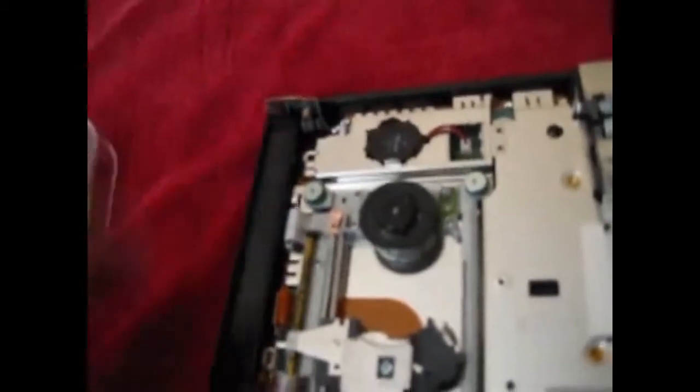The first thing you want to do is take off all these little plastic or rubber squares on the back of your PlayStation 2, and then take out all of the screws. Once you've done that, you should be able to open up your PlayStation 2 just like so. Just go ahead and pop it open — make sure it's right side up.